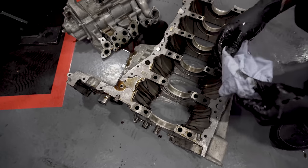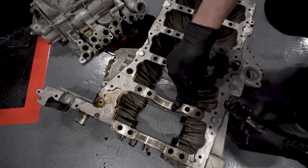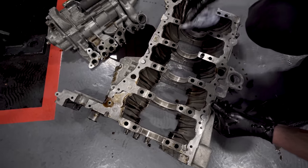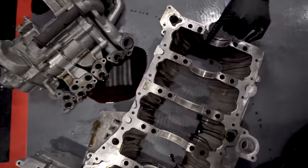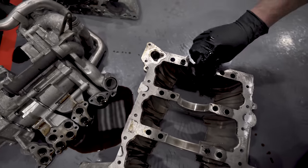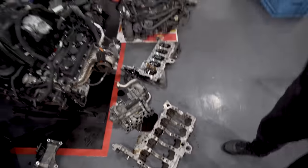So there's no debris, that is just mileage. There's no scores, there's no wear, it's just starting to pull through on the top coat. I bet if we looked at the crank, there's nothing on it. Like here, do you see that spot there? That's the worst one. Just where the bearing's starting to come. You could find that's a little bit of imbalance as well, because that's number one, right on the pulley. So that's just a wear spot coming through because of balance.